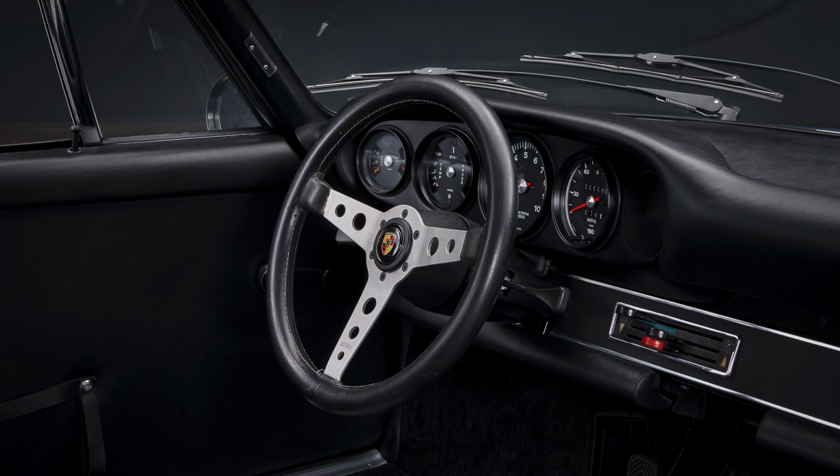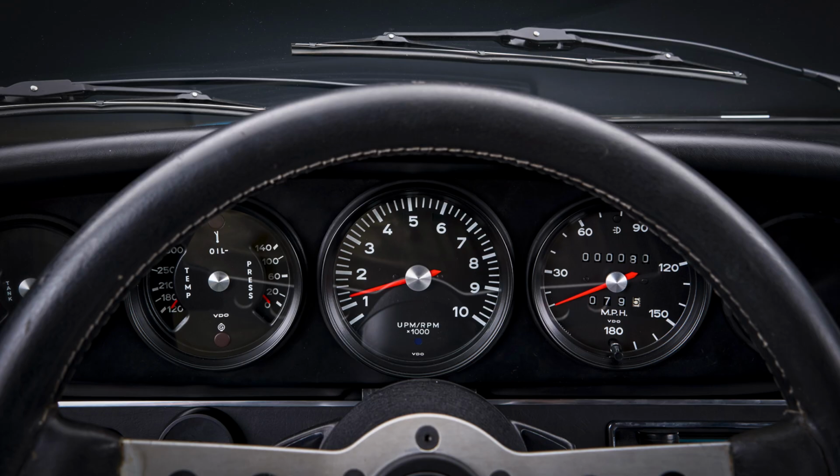That's an old one. It's vintage. It's not a repop. Sometimes I build an entire car just around the steering wheel. All the gauges are custom done by Palo Alto and obviously modified for the Bosch injection. The TAC has the Autometer stepper motors in it, which is a very expensive upgrade. 180 mile per hour speedometer, 10K TAC, everything restored.